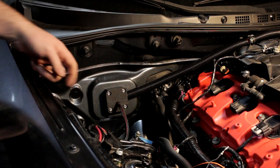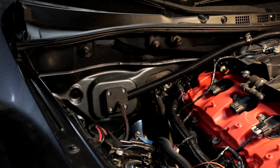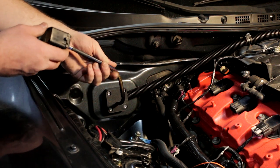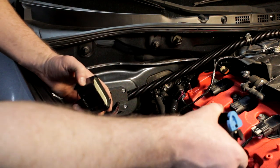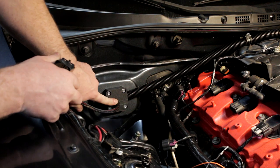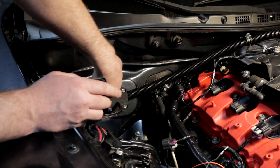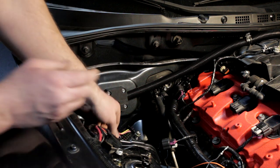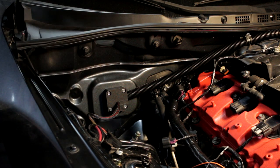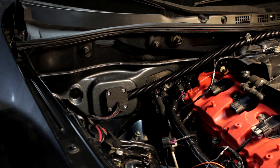Here's what the finished product looks like. You've got the cable that runs over to the starter — I still need to run that down and put the end on it — and this bundle of wires in loom mounts to part of the harness. The harness comes through the middle like I showed, and the battery cable comes in through the side and gets routed at an angle down through the firewall. Now we've got both the battery cable and harness running through, so we'll finish running the battery cable all the way to the trunk.